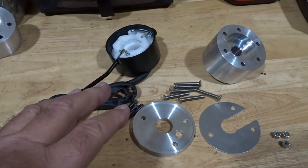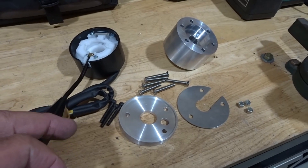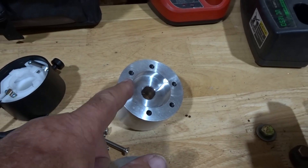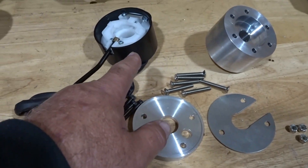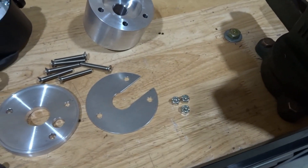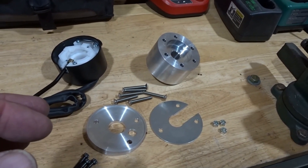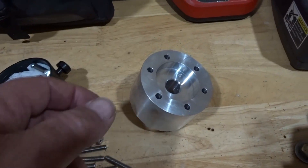Let's take a look at the unit and I'll show you how everything goes together. These are all the pieces that come with your turn signal switch, and it will be fully assembled when you get it. The machine screws for the steering wheel will be placed inside the steering hub and run in so you know where they go and how they assemble. The angled spacer will be mounted to the turn signal switch, and the backing plate will be fastened using three Allen head screws and three locking nuts. Everything is ready for you to disassemble what we're providing so you know the order in which it all goes together, then install it in your car.